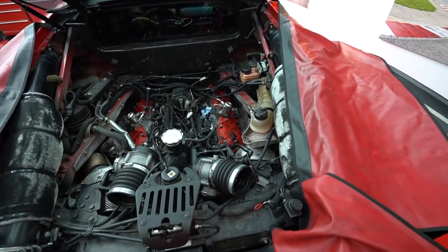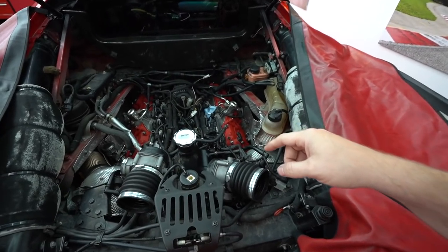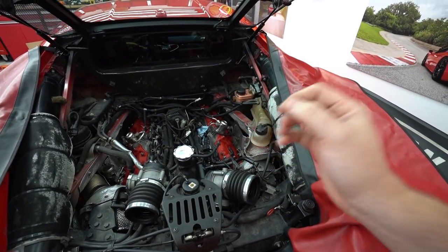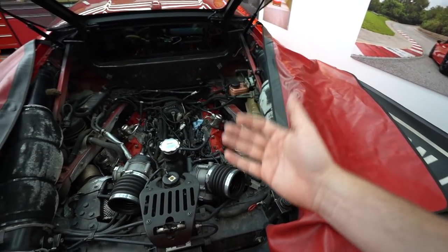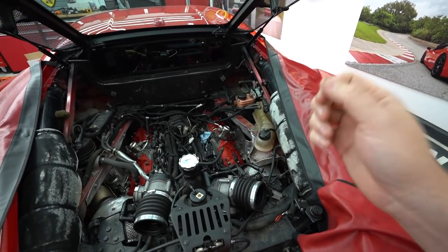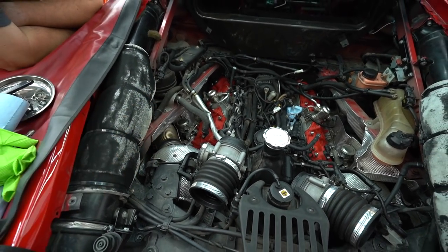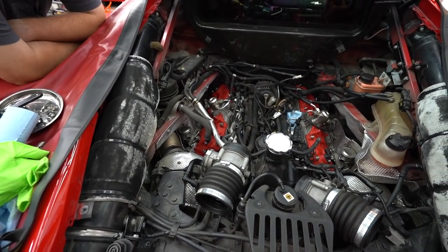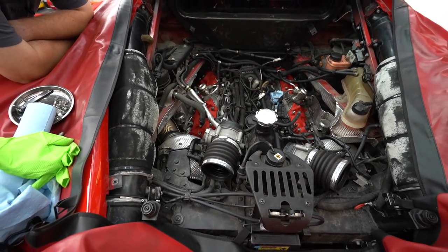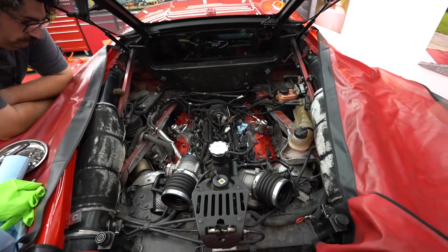The good news is when we had the valve covers off on the right bank we noted where the camshaft positions were. Cylinders two, three, and four are ready to go because the intake valves are closed. Cylinder one is open so we are going to have to rotate the engine to get those closed. I forgot to check the valve positions on the other side, so we're going to have to stick the camera into each intake port first. My assumption is we probably have one intake valve open just because of the basic timing on a flat-plane crank.